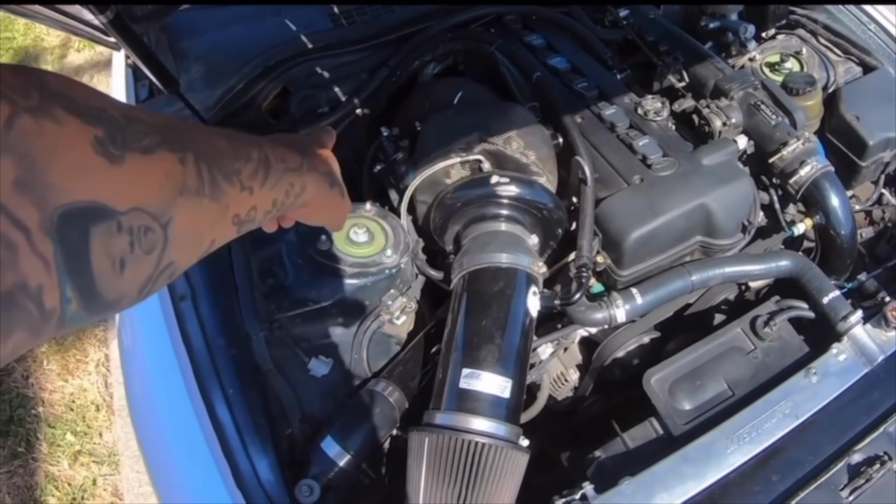You guys know that in the last video we took the 300ZX apart, and since then we've literally been struggling to find this stupid clutch fork retainer clip. I guess certain years of the 350Z use the beefy fork that I showed you guys, but using the beefy fork requires a different retainer clip that holds on the throwout bearing than any of the previous years of the Nissan trans. So the 240SX, the 300ZX, and some of the early year 350Zs all use the same fork. But when I showed you guys the comparison of those forks, the newer style 350Z fork is girthy, is beefy.